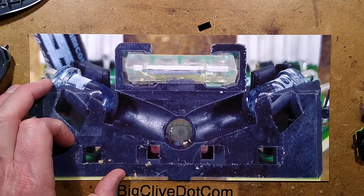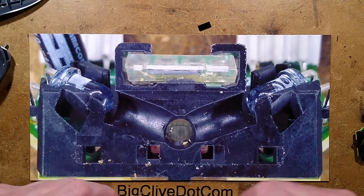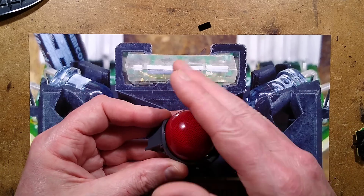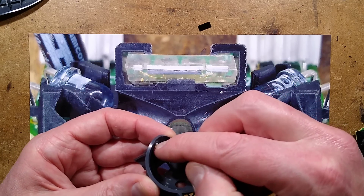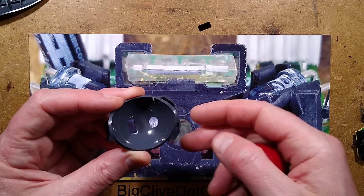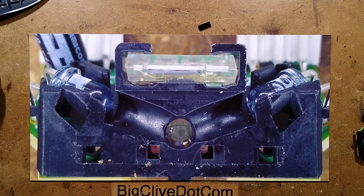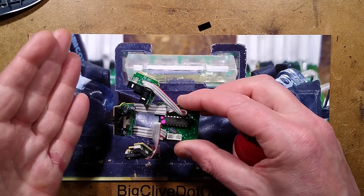In this unit it's done with this sensor and a separate microcontroller that is now obsolete, plus a few support components. But modern mice that you buy from your dollar store or pound shop just contain one chip with the lens on and everything — it's just ridiculous — and then an external infrared LED firing into that. In this case they're firing to the centre, looking at the surface of the ball. This little lens here has a prism behind it that diverts the light up onto the chip, and it does that comparing of images to see if there's been movement. There's a little hole at the bottom for dust to exit.